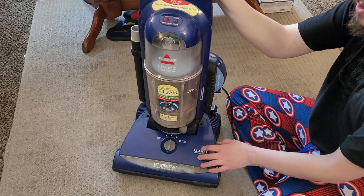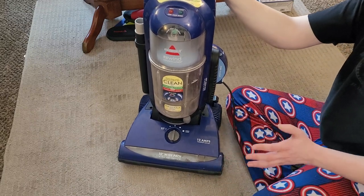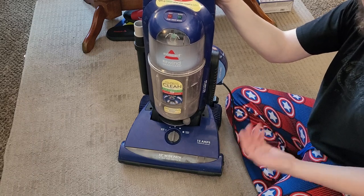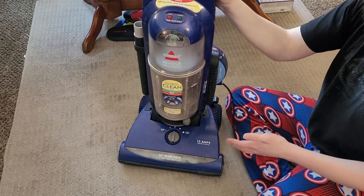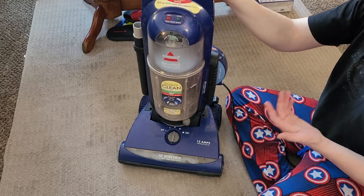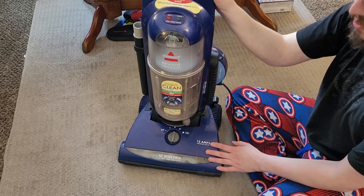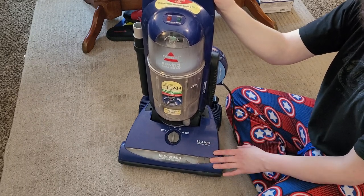Don't use this on bare floors. It will scatter debris, damage the machine and your floors. If you need to clean bare floors, get a bare floor attachment that attaches to the hose with some extra extension wands and use it like a canister. But with how cheap you can get basic stick vacs like the Bissell Featherweight or 3-in-1 for $20 to $30, I recommend just getting one of those for your kitchen and bathroom. This machine is way too aggressive on bare floors — it will tear up your floors, the machine, or just scatter everything at your feet.